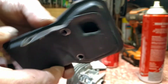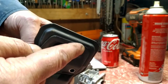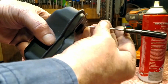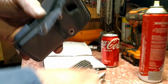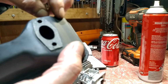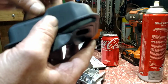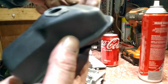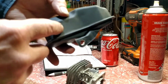But what I'm thinking about doing is putting a pipe for this part here, angled on the pipe, probably about that angle there. A fairly big pipe, say 3/4 of an inch, and anchor the pipe through there, brace it up, and bring the tail of the pipe in here and brace it so it can't snap out, and point it up so it can race straight in, bounce off that wall, and the exhaust can get out there. It can still come out through the front, but this is what is really retarding this saw.